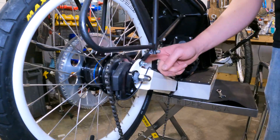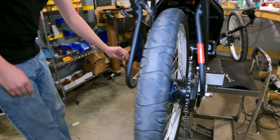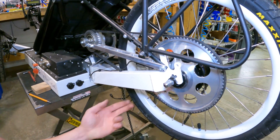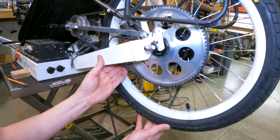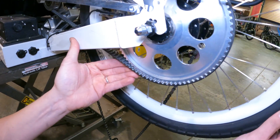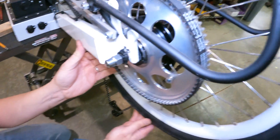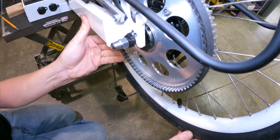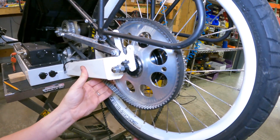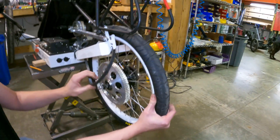Now we've got the chain pretty well free on this side, we just need to worry about the belt on the opposite side. This belt is currently under tension, so it's not going to want to slip off. But if we encourage it from the underside and pull it towards the frame while rolling that wheel, you'll see that it starts to move outwards on that pulley. You don't need to push too terribly hard — you're just trying to coax it over little by little. Once maybe a little over half of that belt is on the outside of that pulley, start to really push harder, and hopefully get the front of that belt off. There it goes, and our wheel is off.